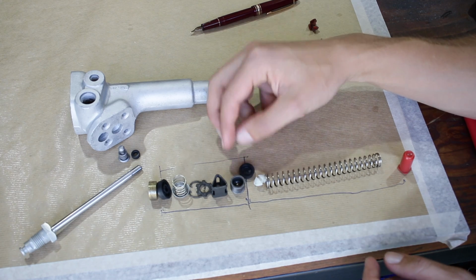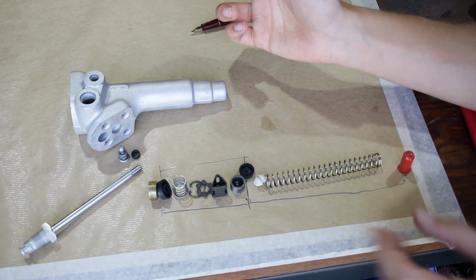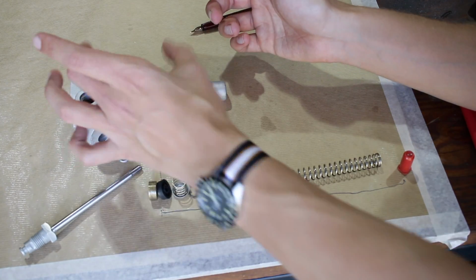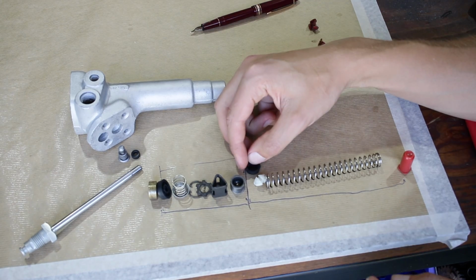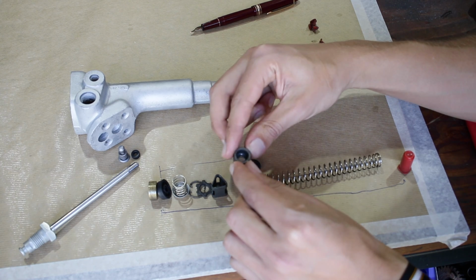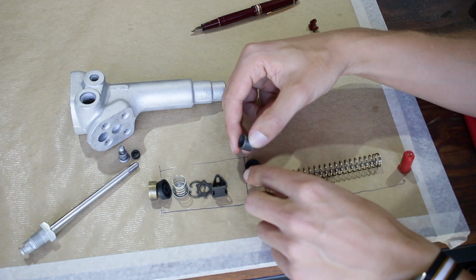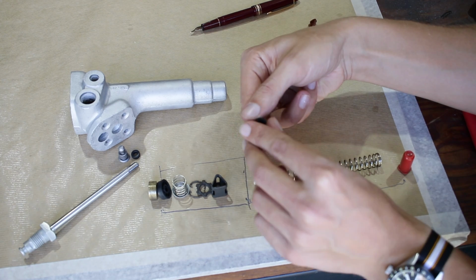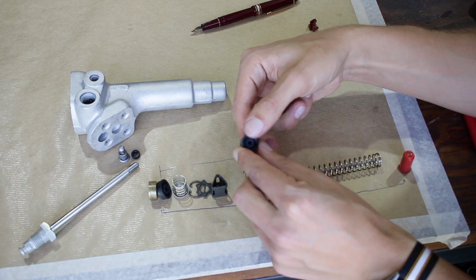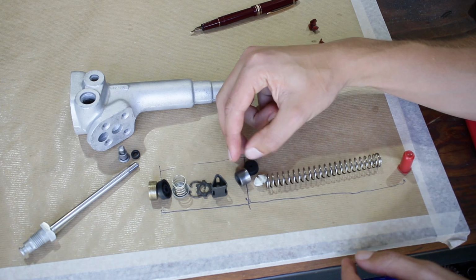And the way that this works is when you put your foot on the brake, you get the usual pressure from your brake master cylinder, which will fill up this first section. And usually, if you had no vacuum connected or anything like that, that fluid will be able to pass through the hole in this piston and then just continue on its way. And because this has a seal on the other side of it, and there's a hole in the middle of that seal, the fluid can just make its way through and continue down to the brakes sort of unboosted.